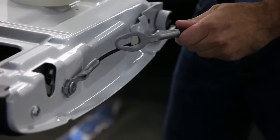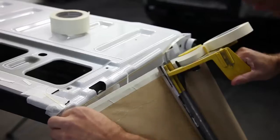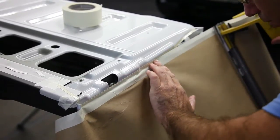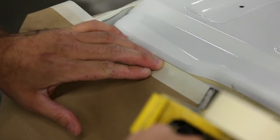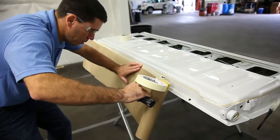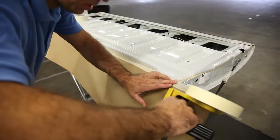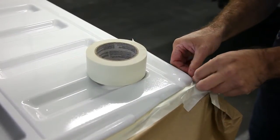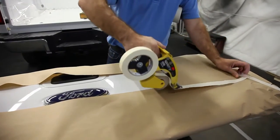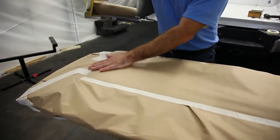It's also helpful to use masking tape to tuck and secure the cables on the sides of the tailgate where they are out of the way. This will allow for greater adhesion for your masking tape and masking paper. Continually inspect the masking tape of the tailgate to ensure a tight seal. Begin using masking tape and masking paper to thoroughly mask off the tailgate. Be careful to create a tight seal to ensure no Rhino Linings material gets through the masking and to avoid overspray. Turn the tailgate over and finish the masking process.